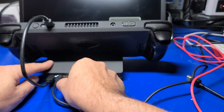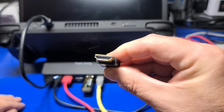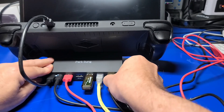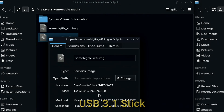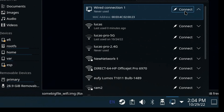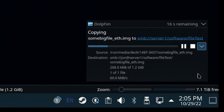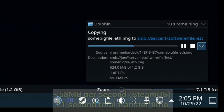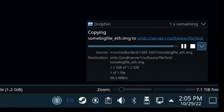I'll plug in the same cables used for the official dock test minus the DisplayPort cable, and perform a file transfer test within SteamOS Desktop. With everything connected, we'll copy a 1.2 gigabyte file from the USB 3.1 stick over to the NAS. After confirming the wired ethernet connection is active and dragging the file to the NAS subfolder, I expanded the copy details within Dolphin File Manager — and here we're seeing between 57 and 60 mebibytes per second. That's nearly twice the speed we saw with the official Steam Deck dock, and caching isn't the reason. This segment was recorded before testing on the official dock.